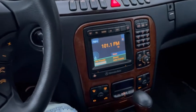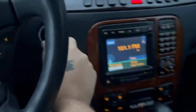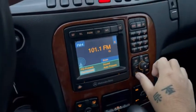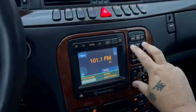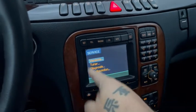Go into the menu and you can find a live battery voltage reading in your car. Just make sure the key is in the ON position, and then press and hold the mute button along with 1 and 3. Hold it for a couple of seconds and the service menu will come up.